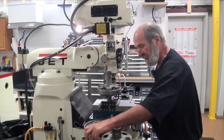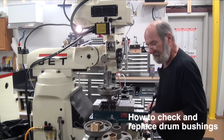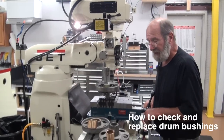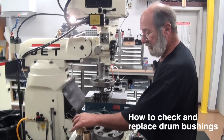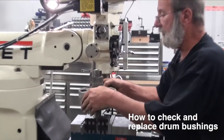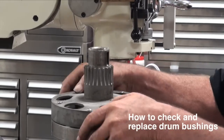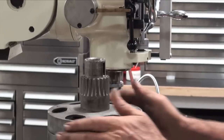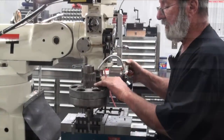These are the bushings from the vendors for the reverse and for the low speed drum. I find that most generally these don't need to be replaced. I check the fit by simply dropping my drum on and looking to see if I've got any side play — and I don't. There's a little clearance, the drum isn't rocking, there's nothing wrong with that bearing. I'm going to reuse it and put a little oil on here.